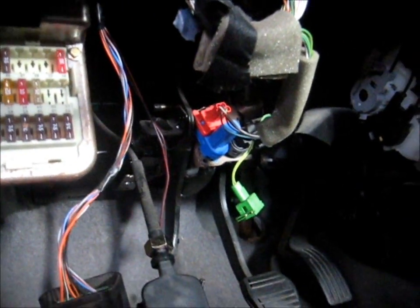Well, I was reading that you wouldn't have to remove the pedal bracket, but I really don't see how you're supposed to not do it. I think it's necessary, so I'm going to get a deep wall 13mm and just pull this pedal bracket off the firewall — this is four bolts that hold it to the brake booster area. I loosened the nuts all the way to the end but didn't take them out. I'm hoping that's gained me enough to slide this out. And apparently it has. Oh, I spoke too soon. Come on. There — there we go. There's the old piece of shit.